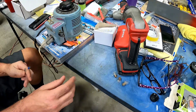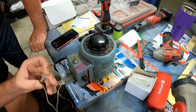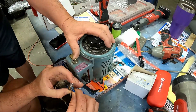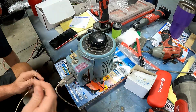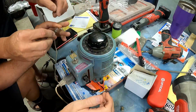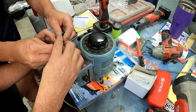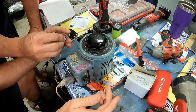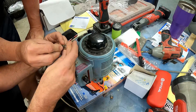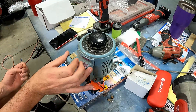To test these, you go one on the base, one in the center, and one on the side. 12 volts. We had a little snafu — this doesn't work when the extension cord is out of the wall. Turn it on — hey, we got a light, it works! There it was — let me hold it because I'm barely making contact. We need to clean them up with a little file — it'll work fine. Those three work. Dash bulbs work — test them before you put them in.